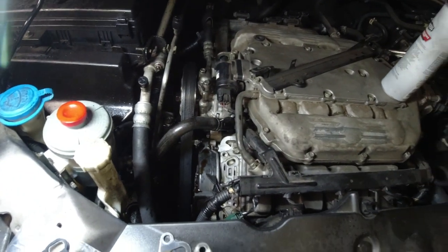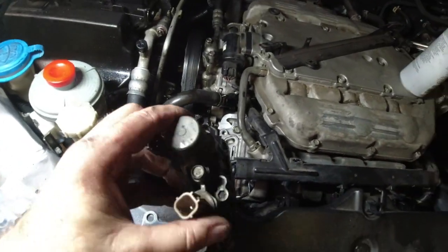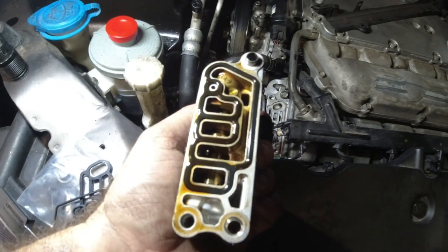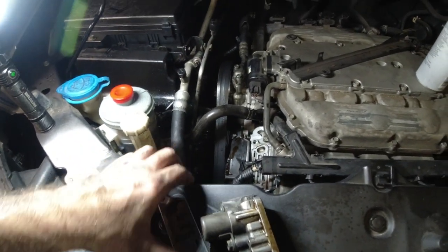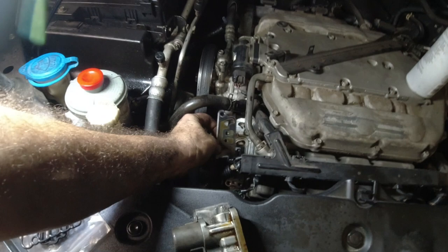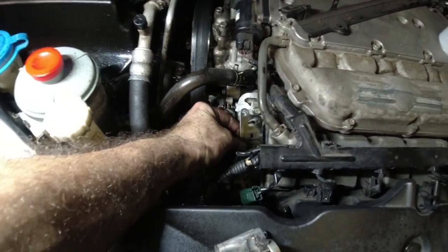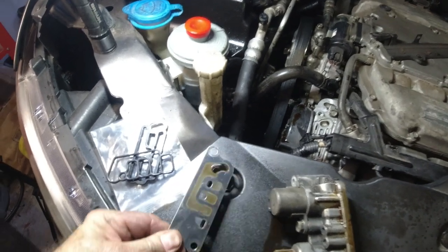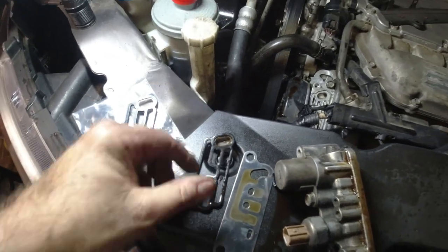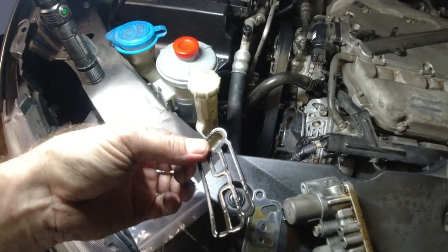You have to make sure: once you take the bolts off, this comes off and there's a gasket right here. I bought a little kit — comes with both gaskets. Then there's this metal plate that was on here, and you've got to pry the metal plate up. This gasket was underneath, so you've got to make sure to replace this gasket too.